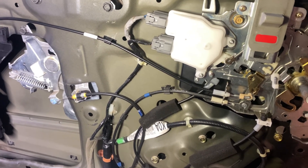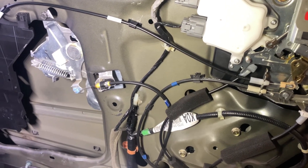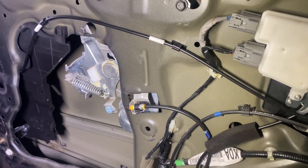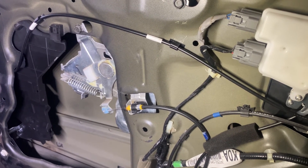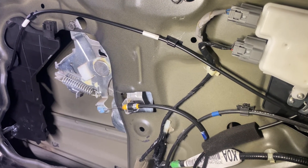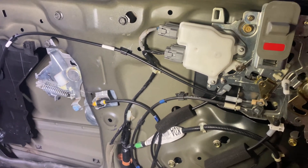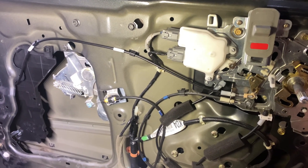So if you guys are having issues with your rear sliding doors closing up on your Honda Odyssey, this is most likely going to be the problem with them. If it's the automatic one, a lot of times you have issues with the whole wire assembly for the motor for the sliding doors. Otherwise, if it's just a manual and it's not latching, then this is how you replace the latch assembly on it. This one's a 2006 Honda Odyssey — should be about the same steps for pretty much all the Odysseys. I hope you guys enjoyed the video and it helps you guys out. Thank you for watching.